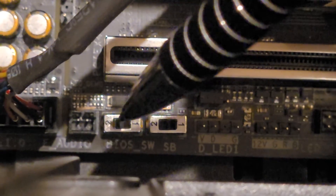Basically, you have two BIOS memories. When I tried to boot up off the default number one, I got a black screen. Taking the computer case off and looking in the manual, I did find this toggle switch. I moved it over to two because I did have a backup of the BIOS, and the computer boots up nicely.